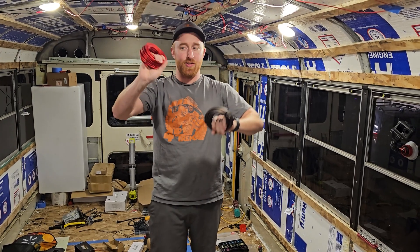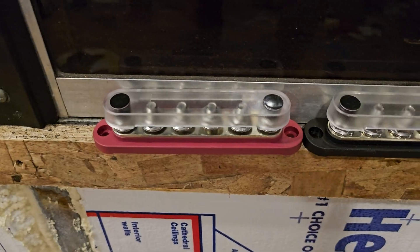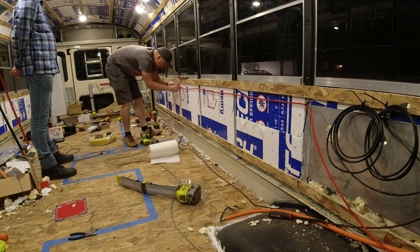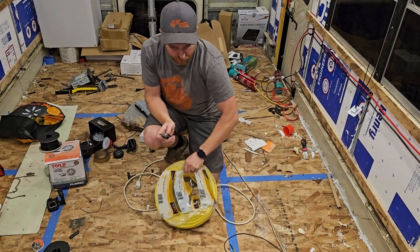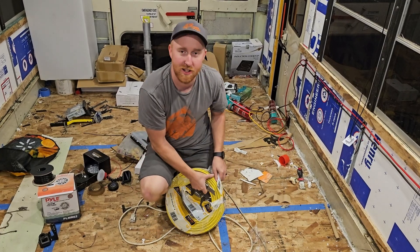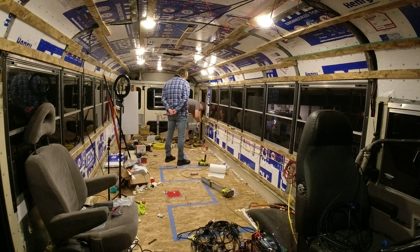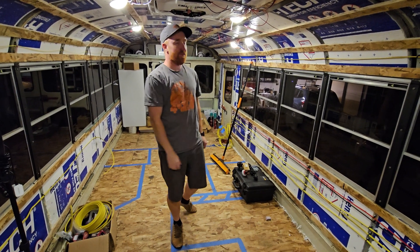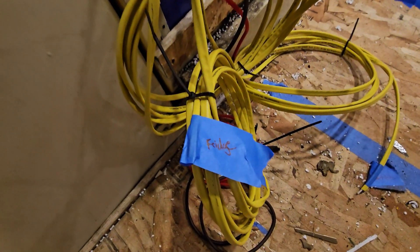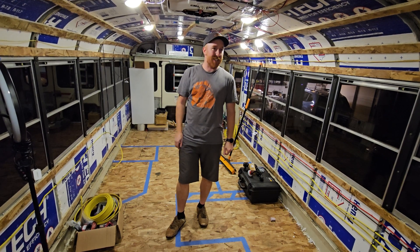First thing I'm going to do is run these 8 gauge wires — positive and negative — from the battery up front, running it back and wiring it back here. Then using these bus bars mounted into the walls, when I want to add anything power-wise to the back of the bus, I have access back there. Throughout the entire bus I'm going to be using 20 amp cabling, 20 amp outlets, and 20 amp breakers. Twenty amp is probably overkill — that's for a fridge, a stove, things like that — but that way I can plug anything into anywhere and be good to go. We didn't film all of it because it was very repetitive, but you can see all the different wires, cables, and circuits along the walls, including speaker wire and excess yellow wire for the side marker lights. All the wiring is pretty much roughed in, which is super exciting.